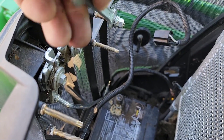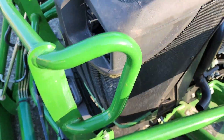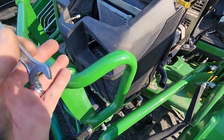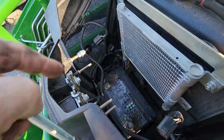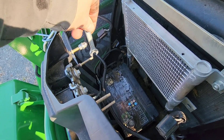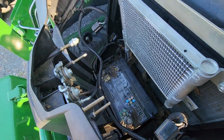This little trick will save you a lot of work. They say to take the whole front assembly — the whole front cowl — off the engine to get to the battery. Instead, just take the lights out and remove these studs. If you have the right tool, probably a special female Torx, you'd be done even faster.